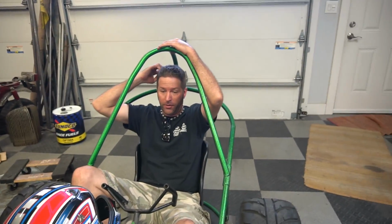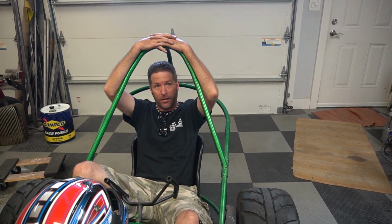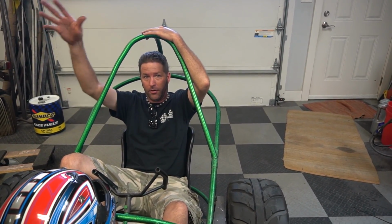I don't know. On paper, our 60-foot time is not any faster, but it does wheelies, and it didn't wheelie before. So I think it's safe to say that these rollers or the different weights in the 780 Go Power Sports torque converter really made a heck of a difference. And I think it sounds better, too. I mean, big old stall, and you hear the cam, you just think race car. Hopefully it'll put us in our peak power band. Yeah, that was the major point. And that'll help us get on down the track.